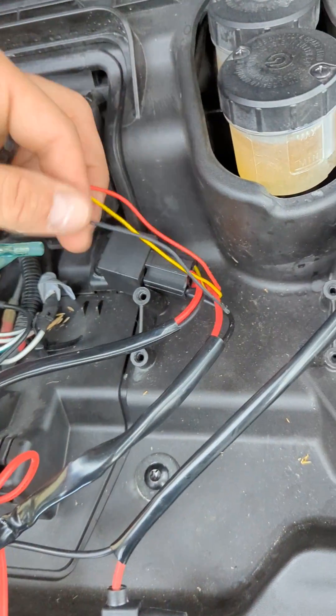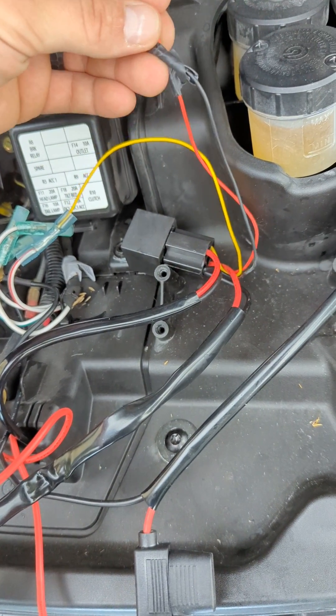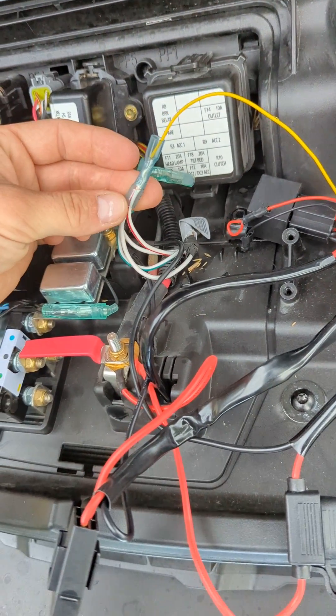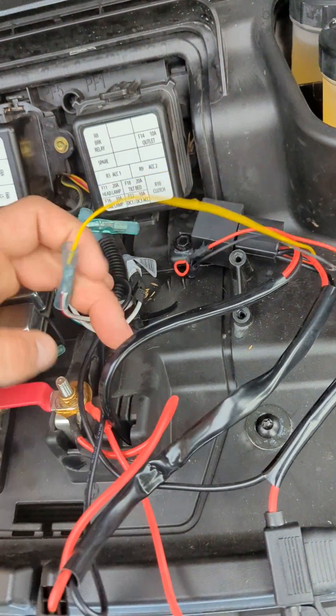You've got three wires coming out of the relay for the switch. I cut my positive and negative — don't need those on this side. You just need the signal wire. This is going to be your positive coming back from the switch, back to your relay to open the relay and turn the light on.